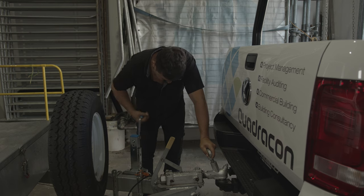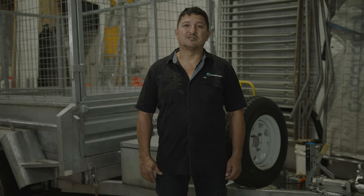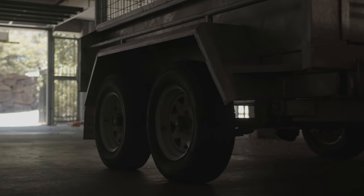When lifting the gooseneck to the same height as the tow ball, make sure that you use the jockey wheel to get to the correct height. This will avoid a strain. Please make sure that you're not distracted on the phone talking to somebody else. Take the time to make sure that the handbrake is on and that the wheels are chocked, especially on sloping sites.